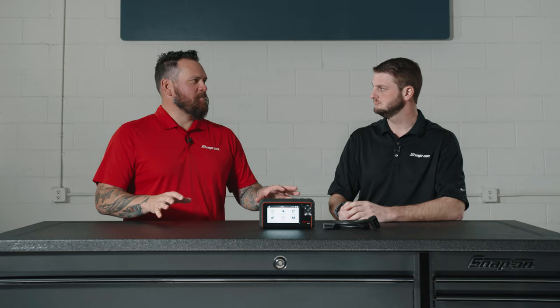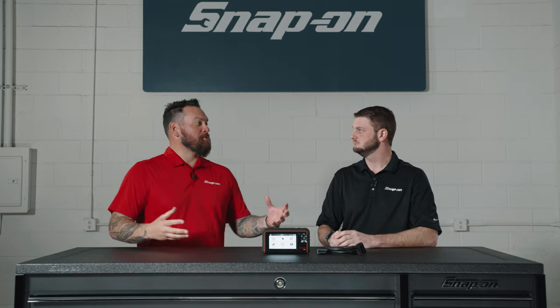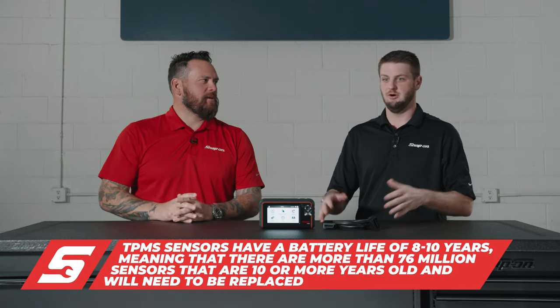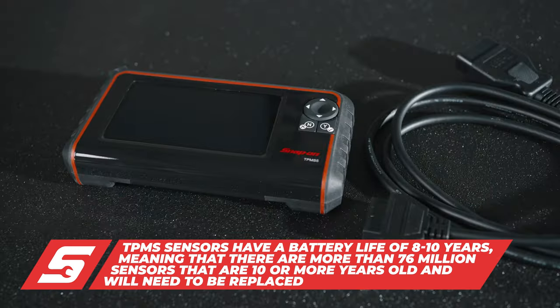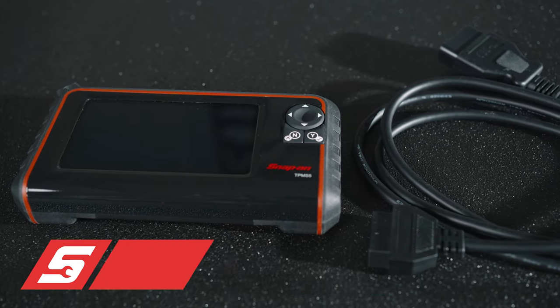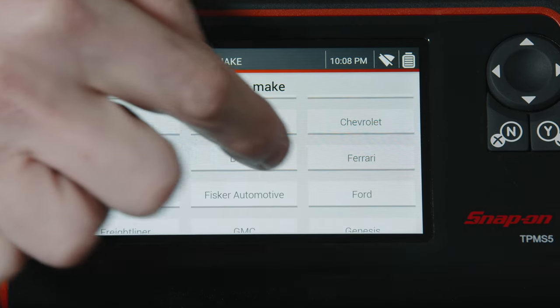The relearn process varies because Ford, GM, and other manufacturers all have different learning procedures to get the TPMS sensors dialed in. GM alone has 33 different relearn processes. So imagine you're changing tires all day and you're working from a 1500 to an Equinox — those are two completely different processes. This tool is great because you plug in, you tell it exactly what the vehicle is, and it goes into relearn automatically. You don't have to look up a procedure; it just does it.